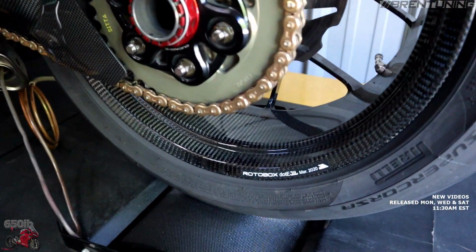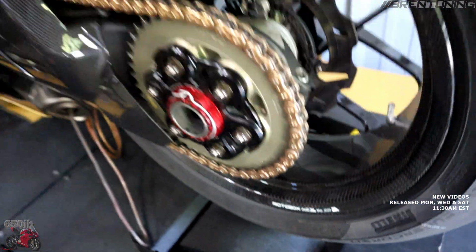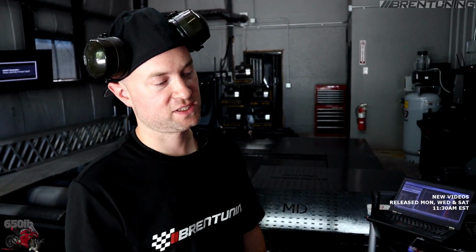So we're going to add our newest feature, which is the injector deceleration fuel cut off. We can actually leave the injector on for more precise engine braking, something that's been worked out in the last few weeks. Makes Ducati much more rideable because, as a lot of people complain, is the on-off throttle snatching. It just dies when you stop accelerating.